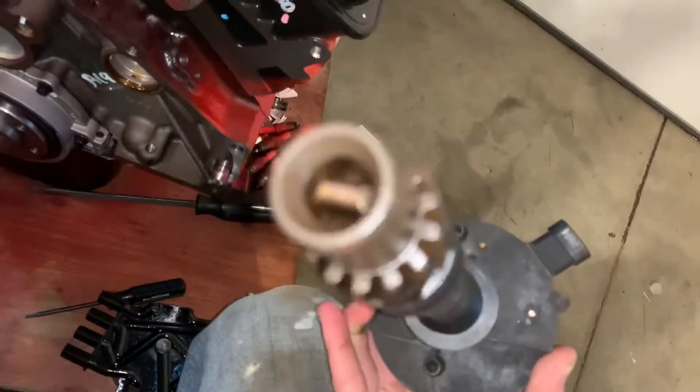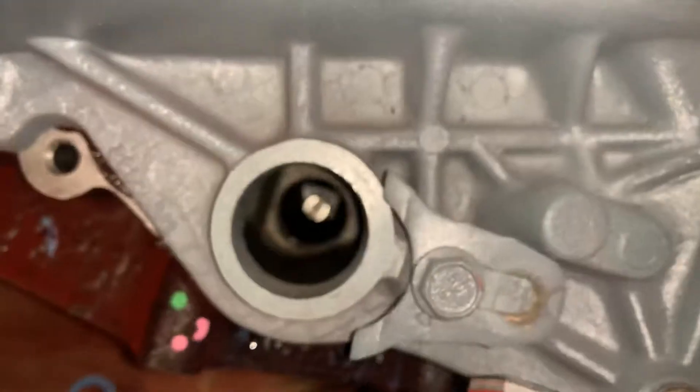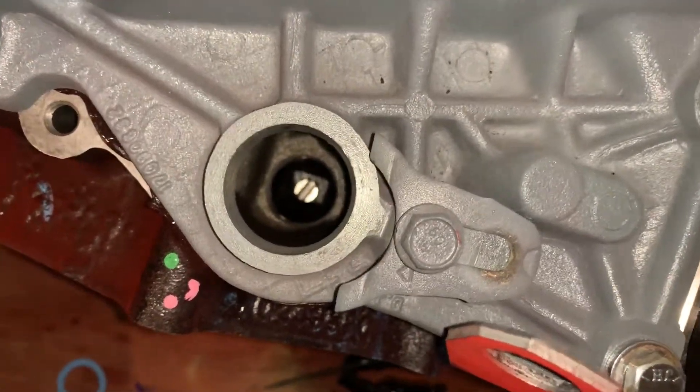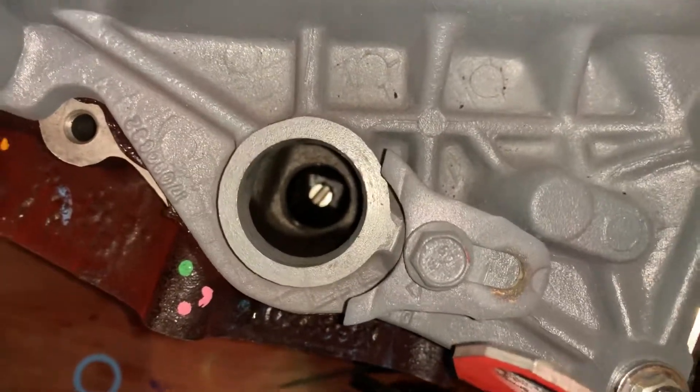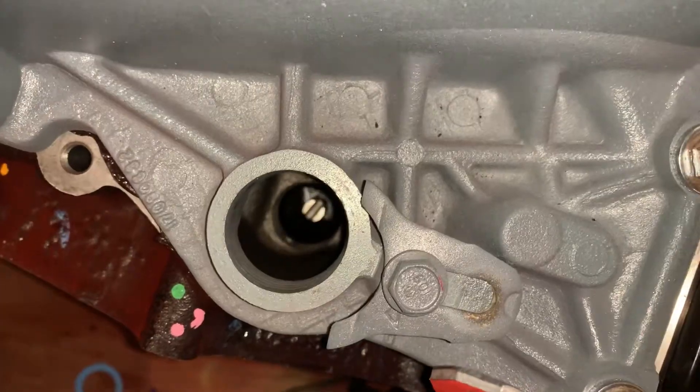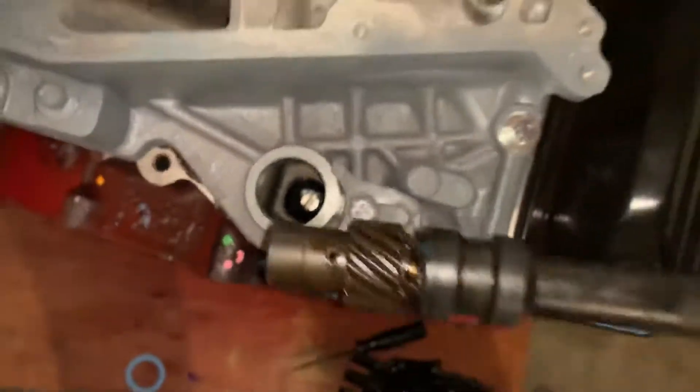Also, that's how the oil pump is driven. You can see this little tooth right here — that drives the oil pump. If you look in there, what you see right now is the oil pump shaft. That's driven from the distributor, and just to the left of the shaft — you can't see it — but to the left of that is the camshaft gear that meshes with this gear here.